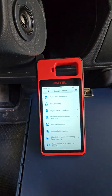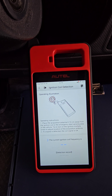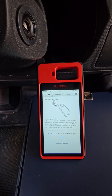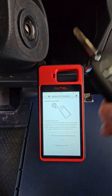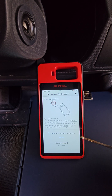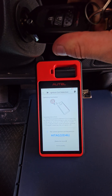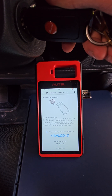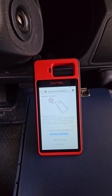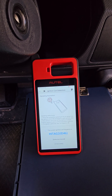So I'm going to take my programmed key, and we're going to start with that one first. I'll select Ignition Coil Detection, and it's given me some instructions — it wants our key tool with our antenna near the ignition, and then it wants the ignition to be turned on. I'm going to turn the ignition on and pay attention down here. It's going to tell me the signal when I turn it on. There we go — HITAG2ID46. I'll turn it off and try it again. Detected it again. I'm not going to do it in the video, but for the sake of diagnosis, I like to do it about 10 or 15 times to make sure there's not an intermittent no-start issue due to the ignition coil — maybe it picks up here and there.